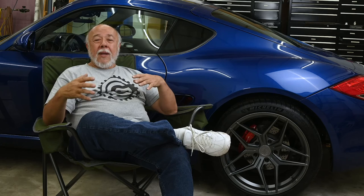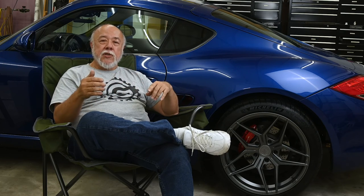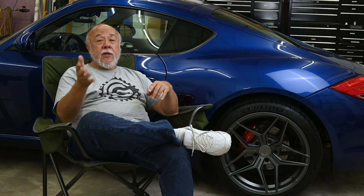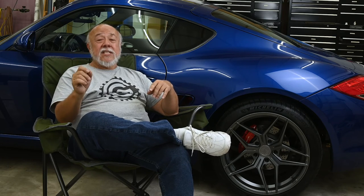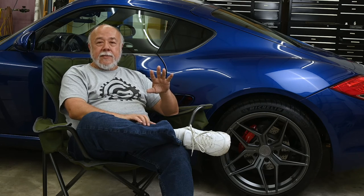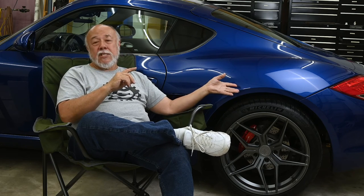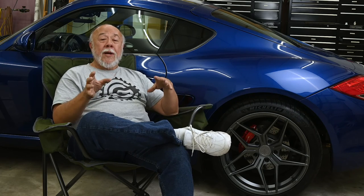So, bottom line, and I'm going to have to go back and make another video amending my review on the Carnewal: you're not going to get a big performance gain on a 987.2 by changing the cat-back exhaust. Now, on the 987.1, you're going to get a substantial bump because the 987.1 had secondary catalytic converters in the back half of the exhaust. The 987.2 got rid of those. And so you're simply not going to get huge performance gains at all, no matter how well you design the cat-back exhaust. I'd be surprised if you saw anything more, even if you went to straight pipes.